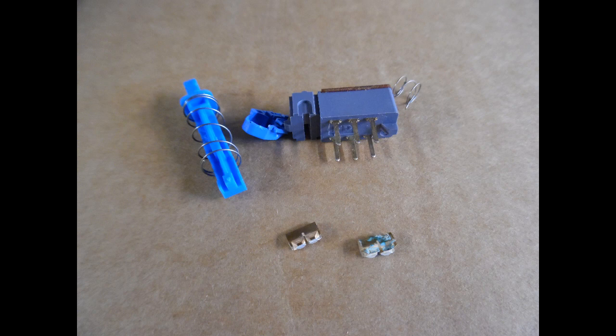The good news is you can source readily available other types of push button switches, as I show in the video. I disassembled the switch, and comparing it with a brand new donor switch, I could see that one of the contacts was bent slightly and wasn't making contact. It had presumably worn and jammed at some point, opening up the contact so that connection was not being made.